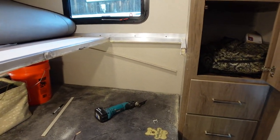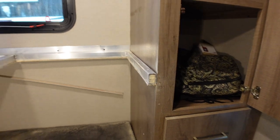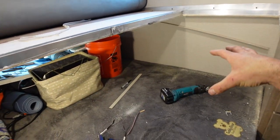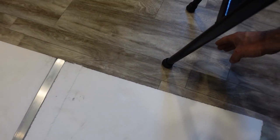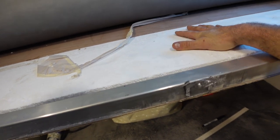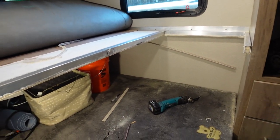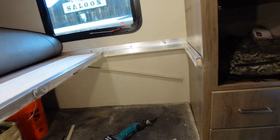All right, so I got the piece out. It's kind of very scary because I just made a giant hole in our brand new travel trailer. This is kind of what we're looking at. What I would like to do is get some of this material — whether it be the actual wood or just vinyl — to cover this edge just to clean it up so it looks nice. I think I should be able to find some sort of vinyl that somewhat matches, and then I'm going to put the trim back up. My plan is to skin the top of this with like half-inch plywood and extend it about six inches so I can put the piece back in here and it's going to overlap up here with plywood to hold it in place. It has three edges of contact. I think it will be strong enough — worst case when we want to use the upper bunk we can just add a support. Still kind of figuring it out as I go.